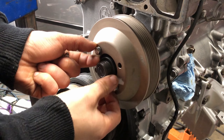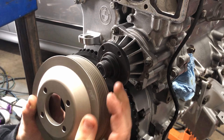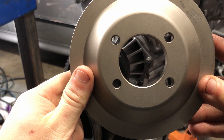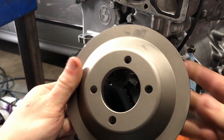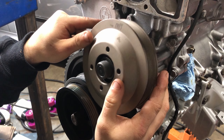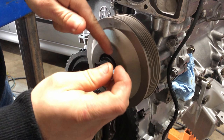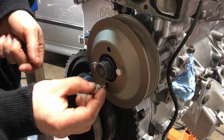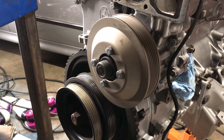Wait a second — why is there no hole there? Did I make some sort of oopsie? So I didn't even realize this, but you can see that the holes on this aren't exactly square — they're actually a rectangle. And sure enough, rectangular format on this. Now the holes line up. I wonder if there's some reason for them deciding to not make it just square. You never know with BMW — BMW is just weird, they like to be different. They're built different. Alright, and then these get torqued down to 89 inch-pounds.